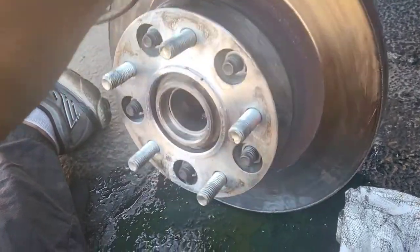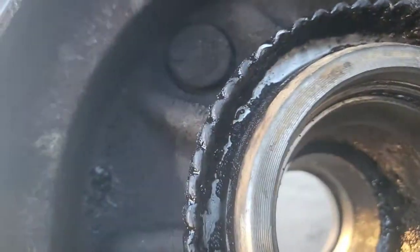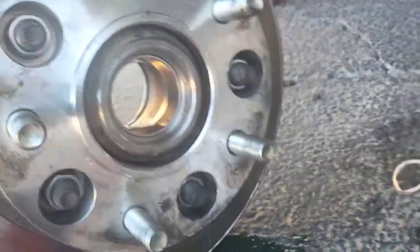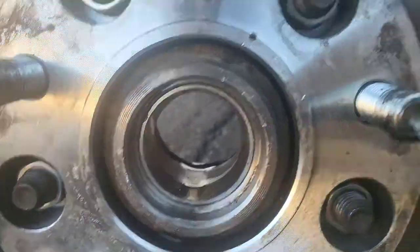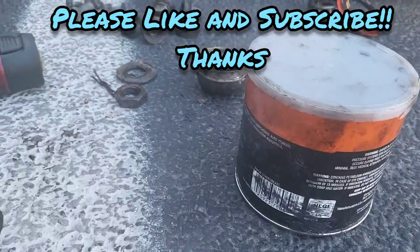as you seat your new bearings. But you want to at least clean out with brake cleaner and paper towels or shop towels, somewhere you can see nice shiny races inside. I think I can reuse these because they're pretty good. If you need to replace them, if they're cracked, you gotta extract them and then press them in. That's another adventure for another time. But on this one, it should be okay. There's a spindle. We're gonna go ahead and finish this up.